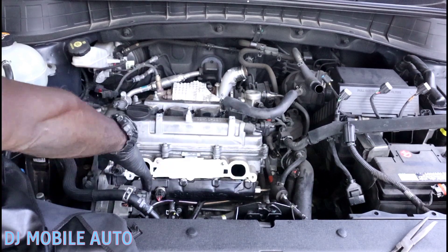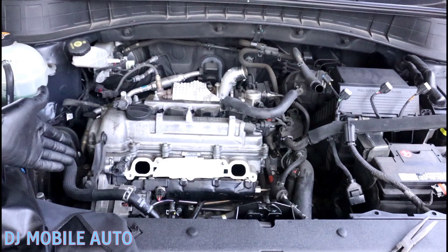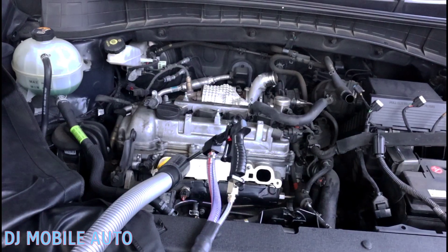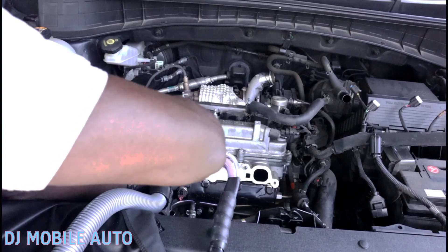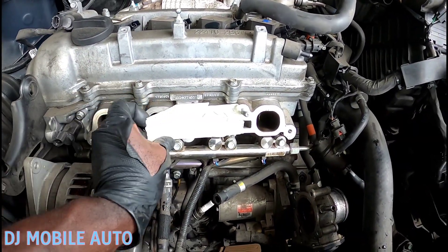This is why I mentioned the masking tape — to cover the ports. I'm covering cylinders 2 and 3 while I clean cylinders 1 and 4. That avoids anything from dropping into those holes while I'm working. I'm going to take a pick and scrape off the excess carbon buildup and deposits on the valves — I'm not going to damage the valves, just lightly scrape off the excessive stuff before I start blasting. The customer is coming for the vehicle soon and it's really loud when the compressor and blast machine are running.